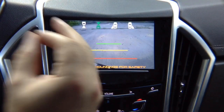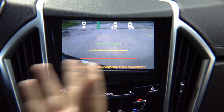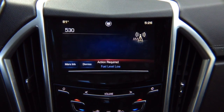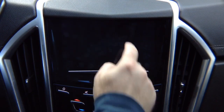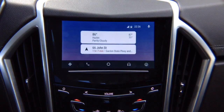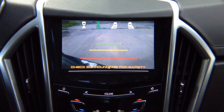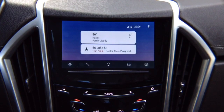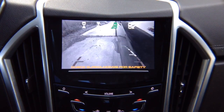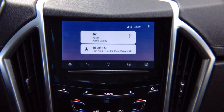In drive, the front view camera activates and shuts off automatically after 10 mph. If no front view camera is installed, when you put it in drive, the vehicle switches back to the factory menu. While in interface mode using Apple CarPlay or Android Auto, the left turn signal shows the left camera, right turn signal shows the right camera, reverse shows the factory or aftermarket camera, and drive shows the front camera — all automatically. If cameras aren't installed, the screen continues showing factory Apple CarPlay or Android Auto.